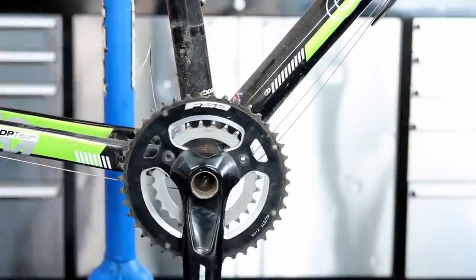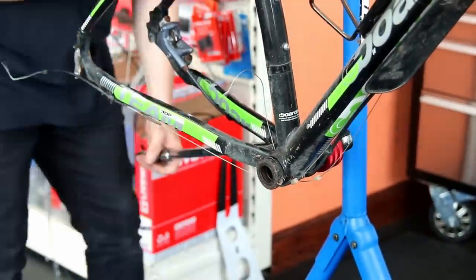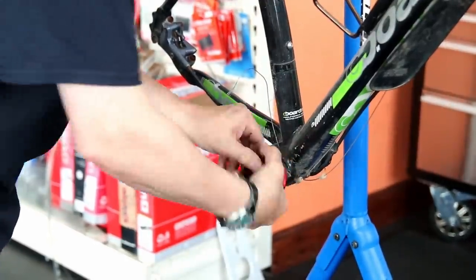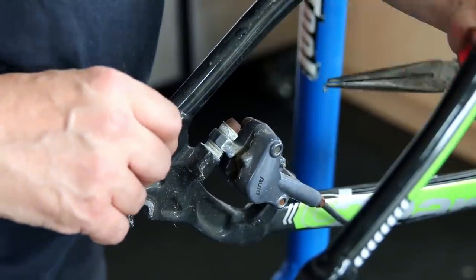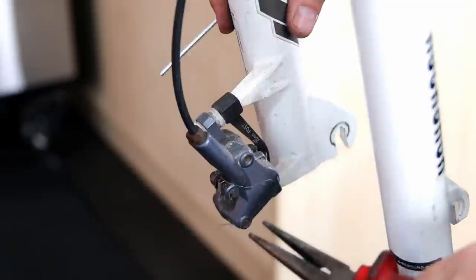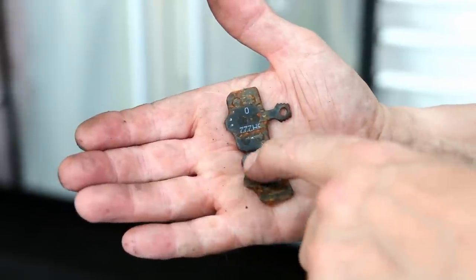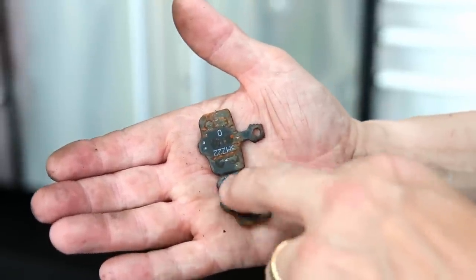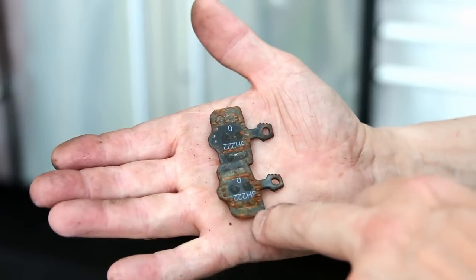You get a randomness of repairs needed on a bike that's sat — some parts will withstand sitting around for decades without deteriorating, and then something else like the bottom bracket here: damp got in, rusted the ball bearings, seized it right up. I wonder whether it might have been these brakes that took this bike off the road — you can see how rusty this is, again from being sat in damp conditions.